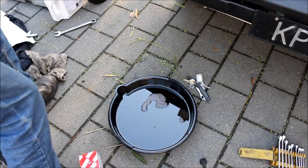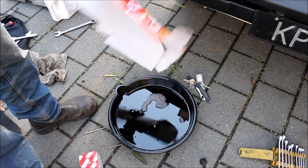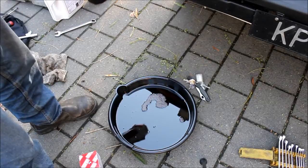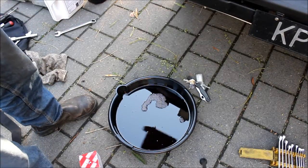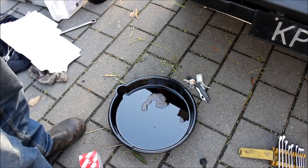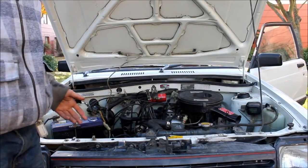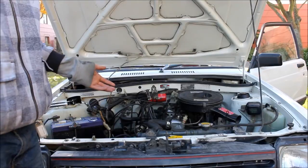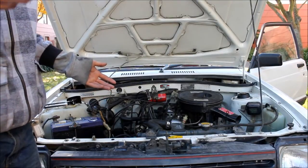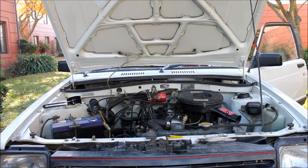A tip for removing your oil filter: if you don't want to get oil all over your steering rack or the ground, find an old cardboard box from your recycling bin and put it underneath the oil filter to guide the oil straight into the drain pan. I've filled it with oil — it's got a new filter so I'll turn it on. It's going to have a rattly timing chain for a couple of seconds; that's just how it works. It's important not to rev it too high before the oil pressure builds up, because that's a good way to destroy an engine.